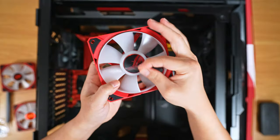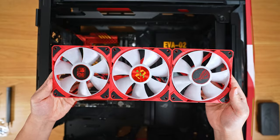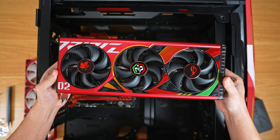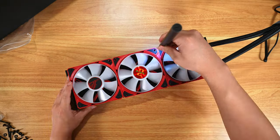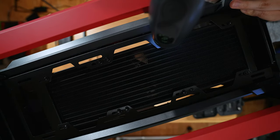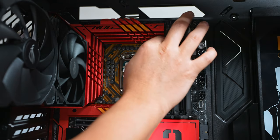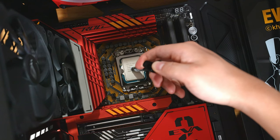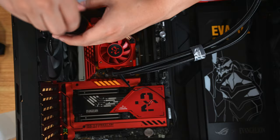Next I want to install the radiator. Check out these fans — they magnetically clip together, which daisy-chains them with just one cable. I love that feature. I also wanted to get the images in the same order as the graphics card. Then we screw the fans onto the radiator and mount it to the top of the case. We also need to get the LGA 1700 bracket in for the AIO. Before that, apply thermal paste — I'm using Thermal Grizzly. Make sure to wipe off the stock thermal paste first. Then install the pump, slap on the screen, and wrap the cables a bit.